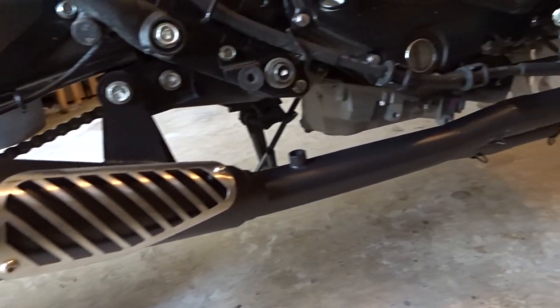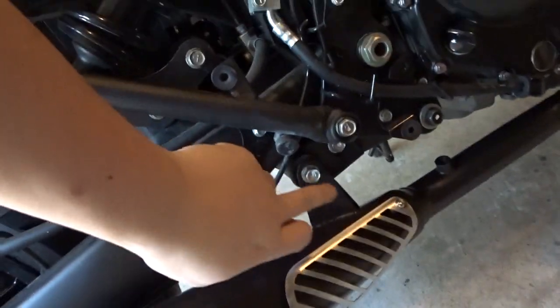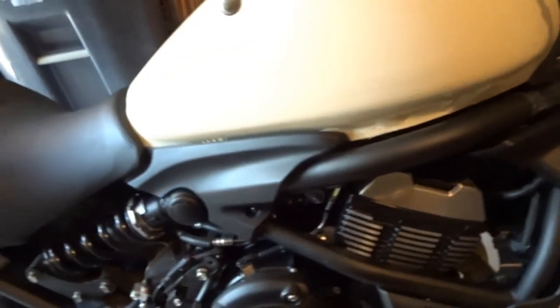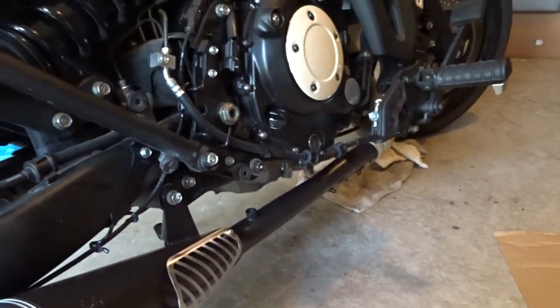She's pretty much on. I left all the bolts on the headers and the muffler mounting kind of loose, just to make sure everything fits alright and everything's lined up the way it should be. Looks good — time to bolt this down. I tightened that down as well as all four of the header bolts. To be honest, I don't know the torque specs on those, so I might have to go back and verify.